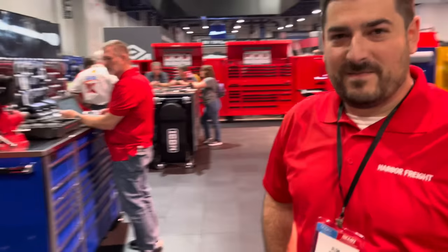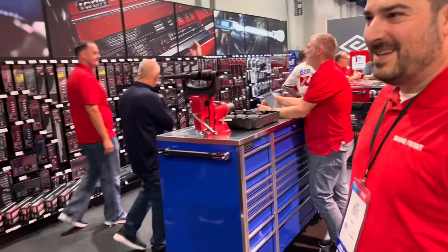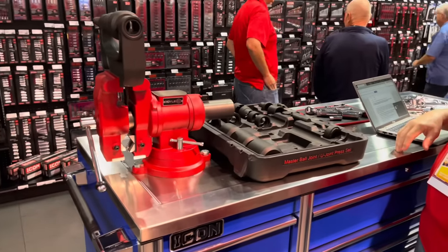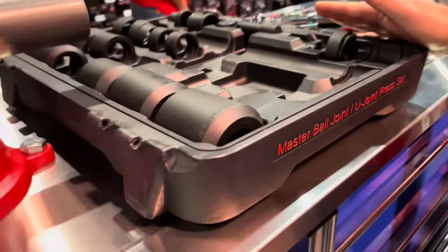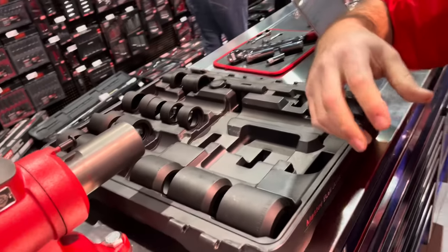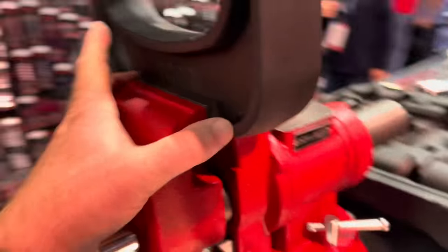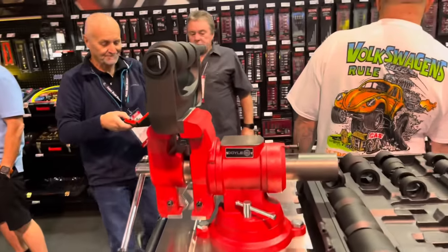Don't click off this video — there's really cool stuff over here. I want to show you this right here, and tell you what the price will be. The tool truck equivalent of this tool is over two thousand dollars — you add a zero to the end of our price to get there. This is the master ball joint and U-joint press set under the Icon brand. All pieces have ball detents in the tool so as you assemble it, you don't need four hands — everything stays locked in place. It's also notched out so you can put it in a vise, since every vise jaw is a different width.